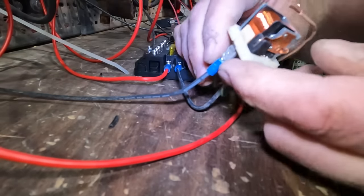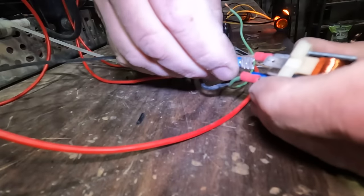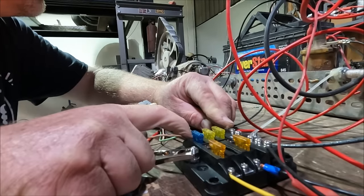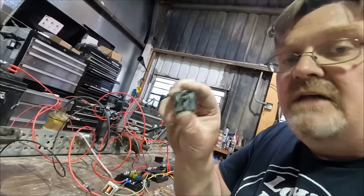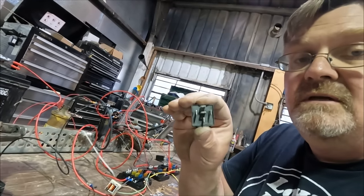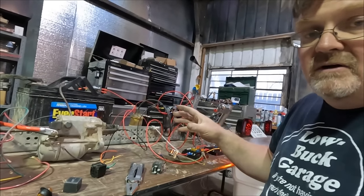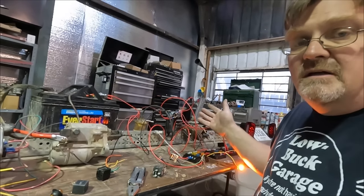Here's the wire for my electric fan — we go to the 87 terminal, trigger it, and our fan is up and running. Going to the 87A terminal, it's normally on — you need to hook up the relay in order to turn it off. Trigger the relay and the fan turns off completely. That's why you only use four out of five terminals: you pick whether you want the 87 or 87A as to whether you want it normally on or normally off. You can wire these things up however you want — with a switch for on and off, or on a thermostatic control. They make a lot of different aftermarket ones, and often they'll include a relay with it.